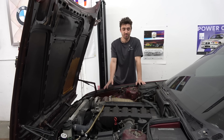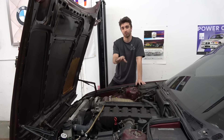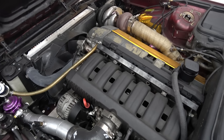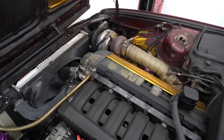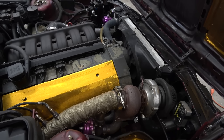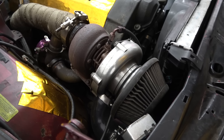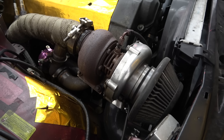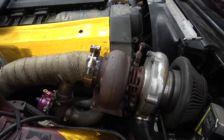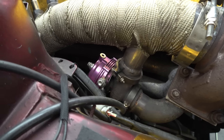What this setup is is the stock M50 B25 Vanos — so it's not the stock engine of the car because this was a non-Vanos car — but stock M50 with nothing other than ARP head studs and an MLS head gasket with a spacer. Otherwise, the bottom end is completely stock internals. We have a Precision 6262 turbo with custom fab work. You can't really get a kit for these — I have an E36 manifold that's completely modified for the E34.